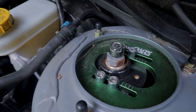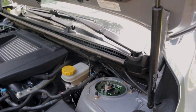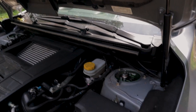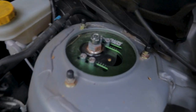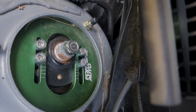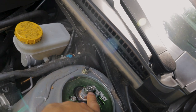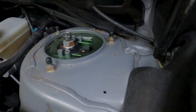The Fortune Autos are a little dirty and slightly oxidized — I could just scrub that off, it's just salt on the exterior. One slight issue I have noticed is a faint squeak at low speeds, but it's almost imperceptible — I just know my car's noises really well. Here is the camber plate — you can adjust camber by taking out these bolts and sliding them over on the black plate underneath. I also have 24-way dampening adjustment here.